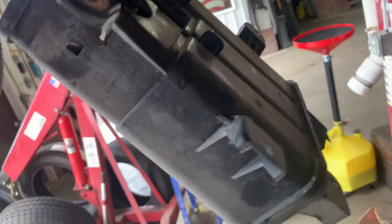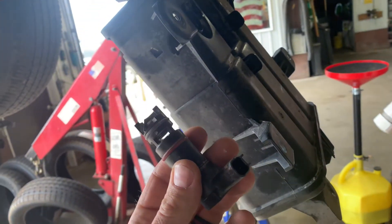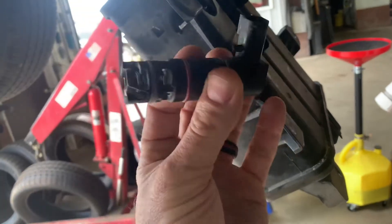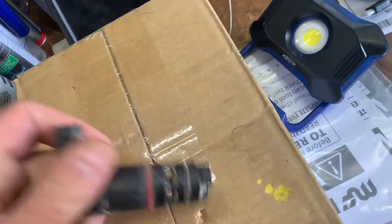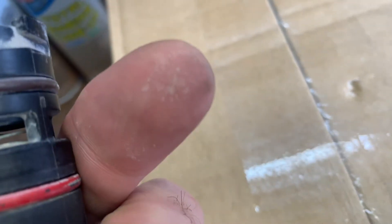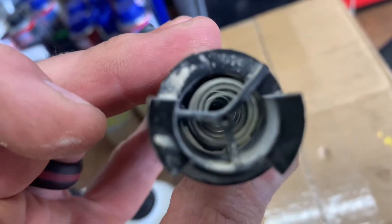So we have pulled this out. You can do a smoke test on this if you have a smoke machine in your shop like we do — you can do that to see if this valve is flowing when it should not, or not flowing. And if we take it over here — yeah, very hard to see on camera, but that is dirt. You can see some of it — see how dirty it is inside there. That dirt has been holding this valve open. See all the dust in the end of it.